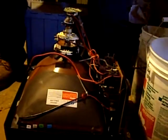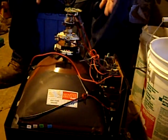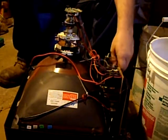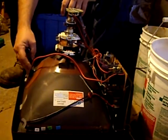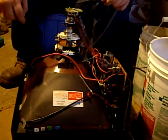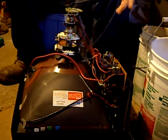The last video on this TV didn't work out, so I switched to this one — the other one I was already done with by the time I realized it. Anyway, this is how you scrap a TV. After you've grounded out the electrical charge inside the tube — you can use two screwdrivers and an alligator clip — stick one in the ground and put the other in under here until you feel it hit the metal clip, and it should be discharged.